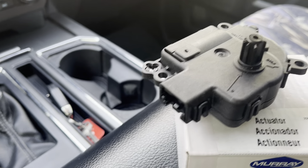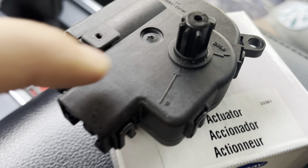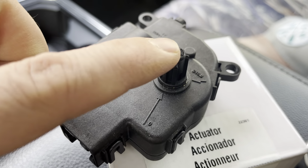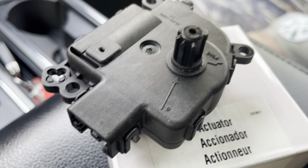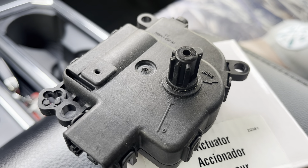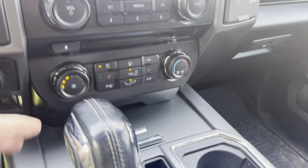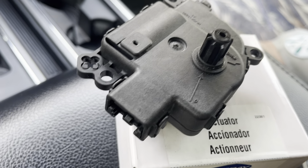You can see it's tough to get up there, but that's what you've got to replace. Now, one thing I noticed — and some people may have mentioned this — when you plug the new actuator in, right away it will start spinning. I think it's searching for a certain position or index, like a home sensor. This happens whether the truck is on or off. When I turned on the accessory mode, it started spinning again.